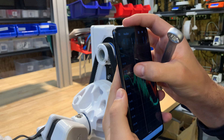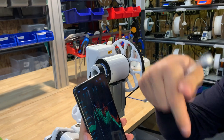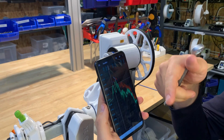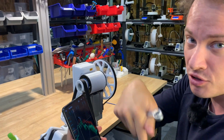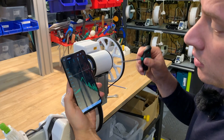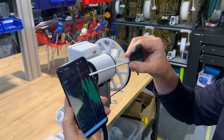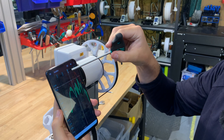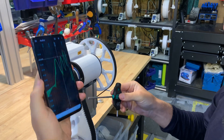I can go in and point — we have the link in the description below to this app for Android. We'll also do a similar one for iPhone, also in the description below. So I've got this plotted in — in this app I can set a mark on 200. This is now 211 hertz, and then we can tap the belt.